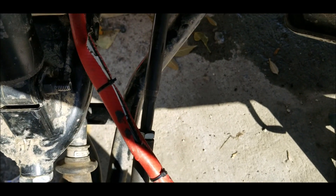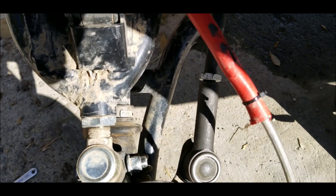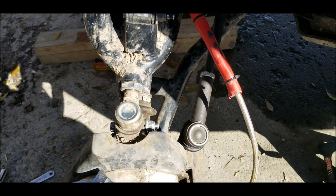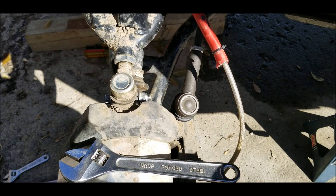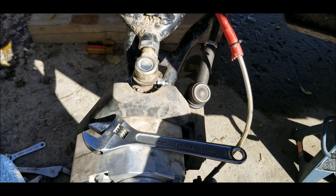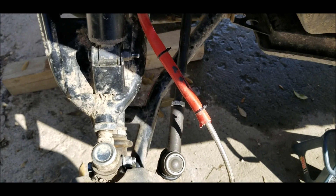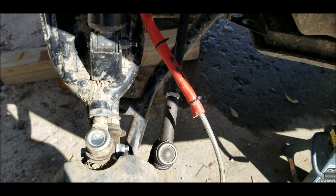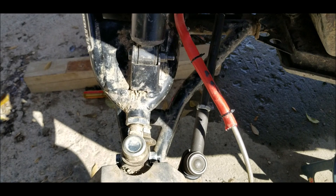So that is all there is to it — Toyota RAV4 inner and outer tie rod ends. Cut three quarters of an inch off. You can find one that has the correct length, but I wanted the largest diameter I could find. It's also very easy to find inner tie rod ends that are nice and short. You can build your own tube with bung adapters for M14 in and out. If you are going to use heim joints, I would highly suggest using SAE thread out on the end — way easier to find heim joints, misalignment spacers, and reducer bushings. Super easy and very cheap to do — no reason to spend a couple hundred bucks on heavy-duty steering parts.